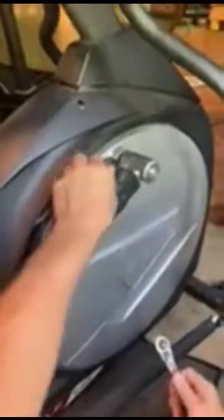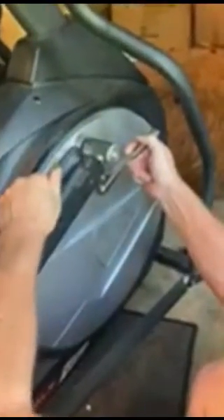So what you're going to do — this is your allen — the most important thing is: don't try and turn this by the allen. Turn it by the bolt underneath here with your socket set, because this could possibly strip. It's hard to be strong enough to turn it by this, so use the allen for holding and the socket for turning.